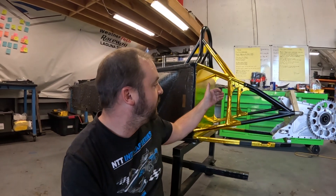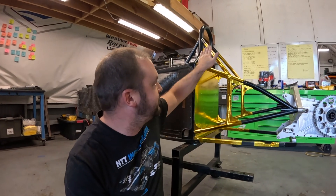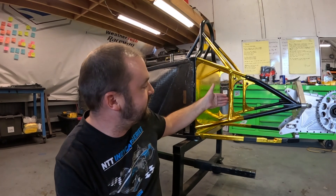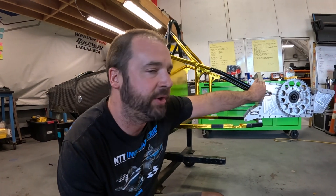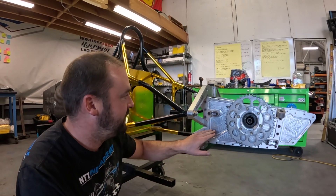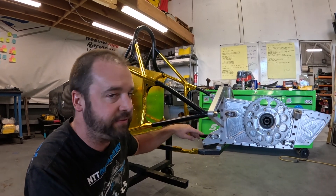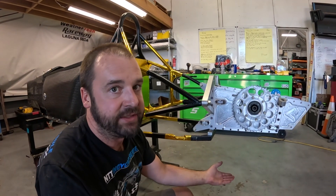Considering this is the first time we're going to be fitting a Suzuki Hayabusa into my car, I figured I should go over the primary changes we had to make to go from the 1000cc GSXR up to the Suzuki Hayabusa. To start, we've got a whole new rear frame from here back, with the exception of the lower truss - all of these tubes and everything back is brand new. You can see there's a lot more width especially down here at the bottom to make room for the wider Suzuki Hayabusa. The termination point back here stays unchanged though, so this hoop and that piece of the spar is the same whether it's a 1000cc or Suzuki Hayabusa. The difference on the spar is the side plates - the side plates now have different locations for the back of the motor for the Suzuki Hayabusa. We also boxed in the bottom of the spar, which will hopefully add to the rigidity of it.